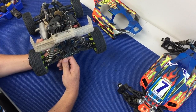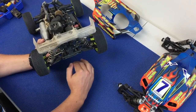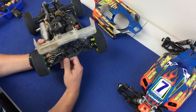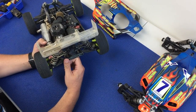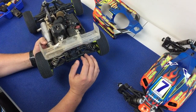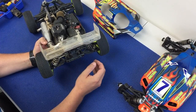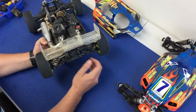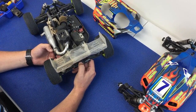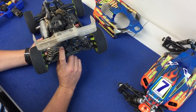Raising the inner link will also lower the roll center and will actually generate more roll. It will kind of help round corners and usually help generate grip. Even though it rolls more, the response or the roll will be a little bit slower — it won't be quite as fast or agile.